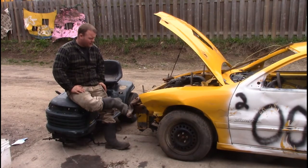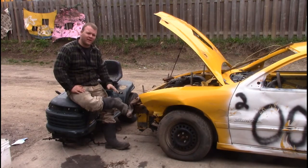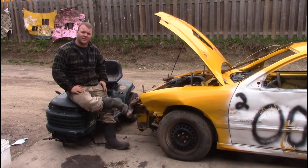So, here in Ontario, we're not allowed to reinforce any parts. Strut, A-arms, lower A-arms. Basically, when we make solid suspension, it's got to be all factory parts, which is kind of nice because it's not a whole lot of modifying. On full-size cars, all you basically do is weld the upper A-arm down.